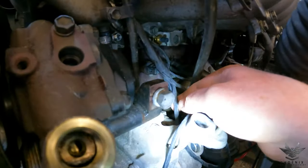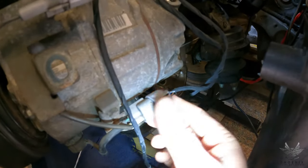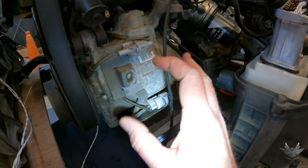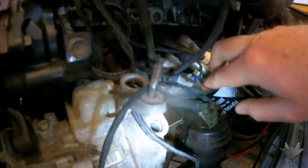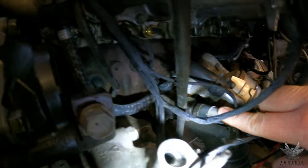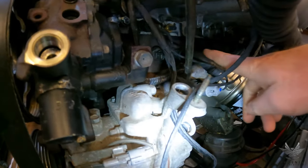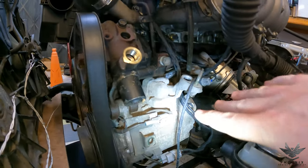Breaking out further along, two long sections come down here — one plugs into your AC, so AC will function as per normal as long as everything is plumbed up right. Also coming out here we have our oil pressure switch, all nicely plumbed in. And last but not least, coming down here we're going to our knock sensor, which goes just over there. That pretty much encompasses everything that comes down on this side.